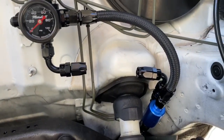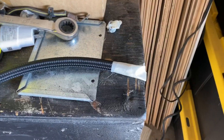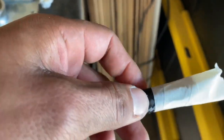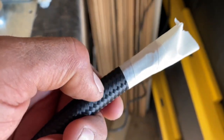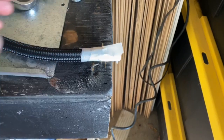Real quick I'll show you guys how I cut the lines. What you want to do is make sure you tape the ends of your lines before cutting — if you cut without taping the ends you're going to mess up the braids, and once the braids get undone it's not going to let you push the line into the end fitting. As you guys can see: nice, real clean, straight cut. I'll take off the tape so you can see what it looks like underneath — the braid stayed together nice and straight, and that's how you want it to look when you go into your end fittings.